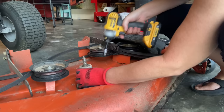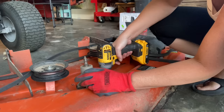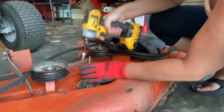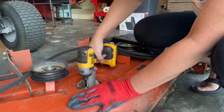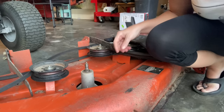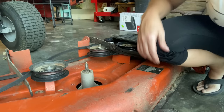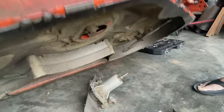We're going to use a half-inch socket to take the three bolts that are left holding the spindle on. I think that one just broke off — and they will. They'll just break off smooth in the spindle, and that's why a lot of times people have to replace them. Even if everything else is fine, the bolts break off in these like crazy. This thing was toast — all four of them broke. That one's still attached to a piece of spindle, so let's flip it on over.